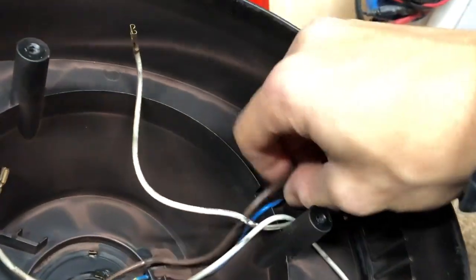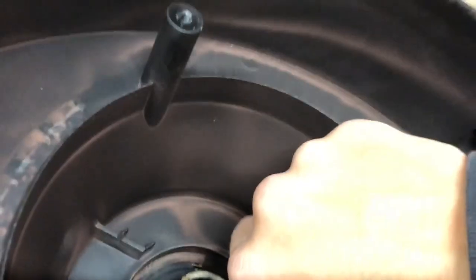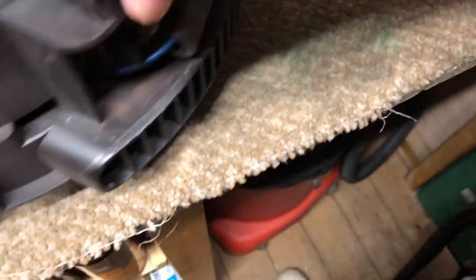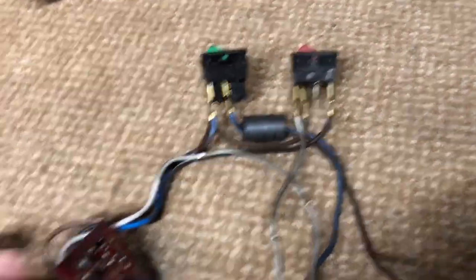Here's the main section you need. This is your PCB — it just lifts straight out. Also while we're under here, we want to remove this brown and blue wire here. So we've got four wires that are not connected to anything. We want to get our flat head screwdriver and just ping the switches out. You might be able to do this without a screwdriver, but I just prefer to use one. These should just really lift out — it's quite easy. Don't worry if wires come disconnected.